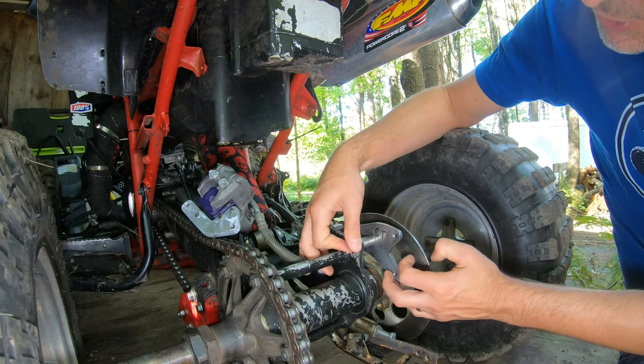I have a new brake caliper — today I should be able to take the factory mount off this new caliper, get it bolted up on the back, bolt up the hydraulic line, and we're good there. After muscling around with this for a while, I looked at the website photos more carefully. I had the master cylinder mounted on the outside, which is what I'd done with what I fabbed, but when it was on the outside you couldn't fit the nerf on. Looking closer at photos on the Crone Tech website, putting it on this side lets you bolt up your nerf. The tabbed plate and these longer screws go on the back of the mount — reaches all the way through for a nice complete clamp.